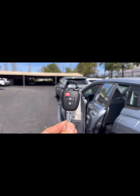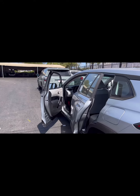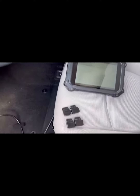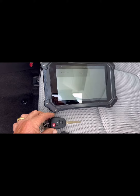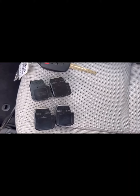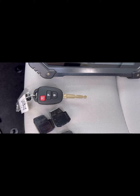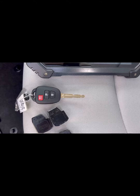It's the same key as the 2022 Tacoma — it's an H chip. On the 2022 Tacoma, I was able to communicate with the remote section and add four different remotes into that new FCC number being used by the Toyota Cross and the Tacoma. The problem comes when you try to add the remote on the Cross — it doesn't see it, and if you try to identify it, it goes under type 2.